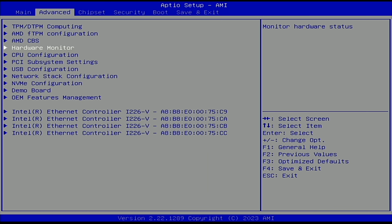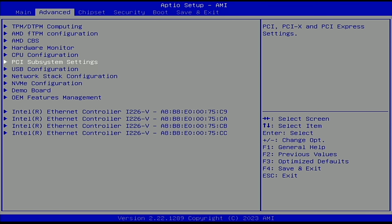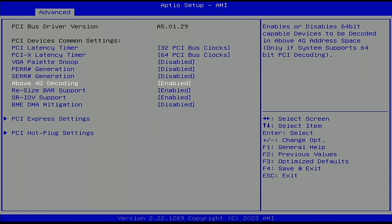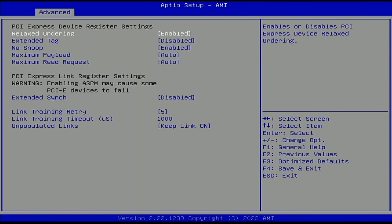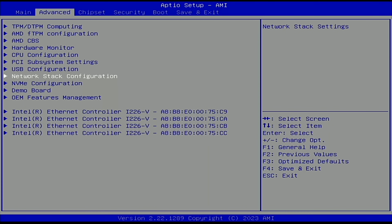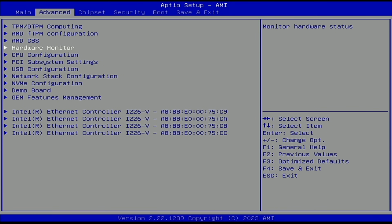The fans are kicking in nicely there, but this is an open box configuration for the Mobo there, so it isn't really indicative of those of you that would put this inside a tight case. Again, when it comes to the PCIe layout there, we'll find out more about the PCIe layout when we dip into UnRAID there and going via the terminal. All of the ports seem to be configured in at 2.5 gigabit Ethernet, which is exactly what we were hoping to see.